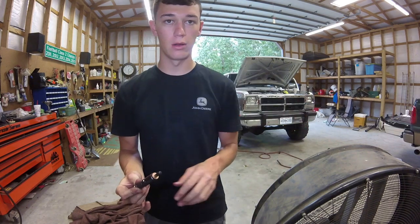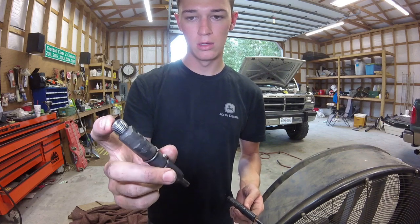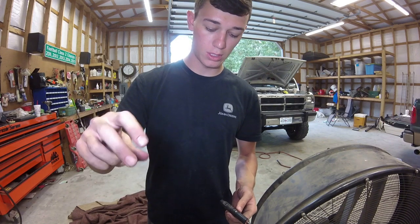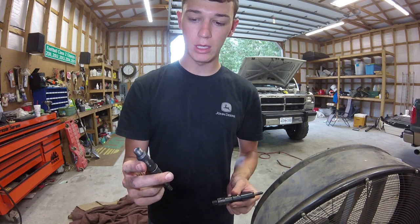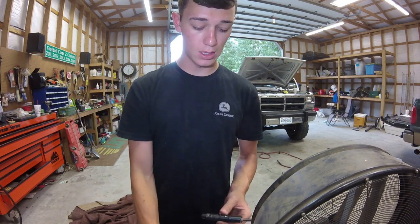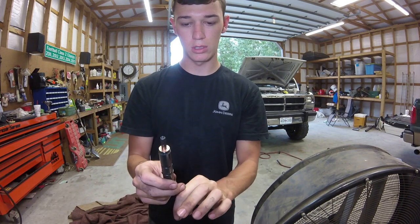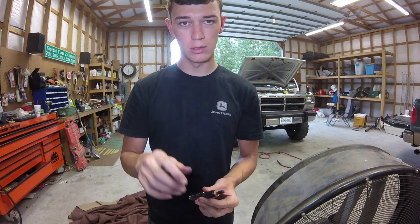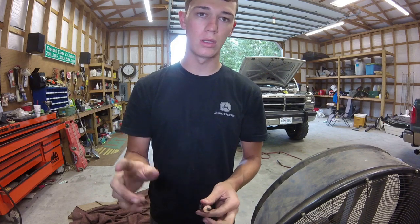Instead of carrying you guys back over there, I'm just going to go throw this in. We're going to give this one some attention. The threads are a little iffy, so we're going to figure out what's going on with those. I think it might be the injector line, the cap that screws on there. Just to play it safe, we're going to run a tap over this to make it nice and clean, and hopefully it'll be good to go. I might run a tap up in that line too. But that's all you're going to do. I buy the thin washers because that's what I was recommended. I think it has something to do with the spray angle, and it hits the bowl better or something. I always forget what they say, but I'm going to go throw this in real quick and I'll get back to you guys.